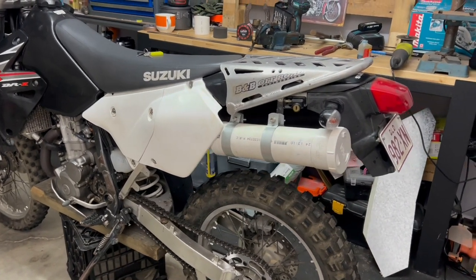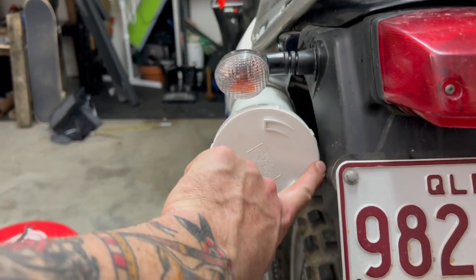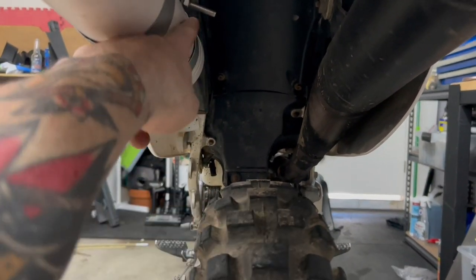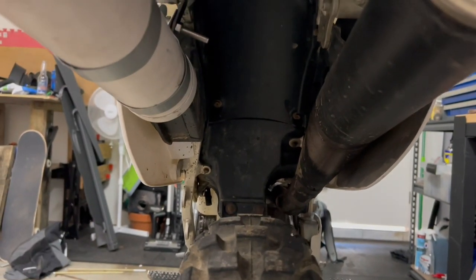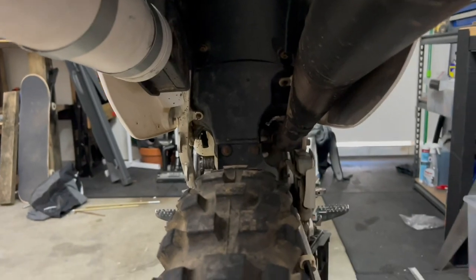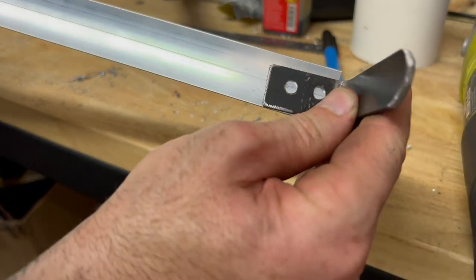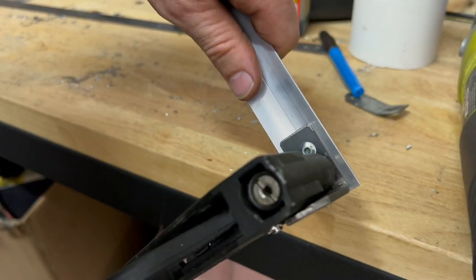It's all mounted up, got the brackets at the height I want them, and that's pretty much how the finished product is going to sit. Pretty happy with how close it is to the guard — it still gives me enough space to take this off and get the tools out. The only thing is underneath I just need to be careful — it looks like it'll miss the tire with suspension travel, but I'm going to keep an eye on it. If it starts rubbing I'll have to come up with a plan B, but I think we're pretty safe for now. I'll just replace these bolts up here, make them a little shorter, and she should be pretty sweet. Moving on to the inside — I've drilled a couple of holes in this channel and made up a bracket to go on the end of it. I'm going to rivet them together — two rivets is a little bit of overkill, but I'm going to do it anyway just to make sure it stays on there properly.